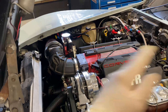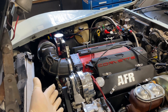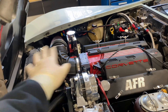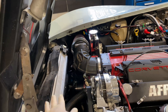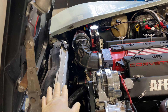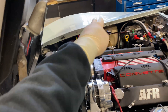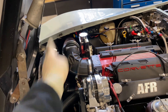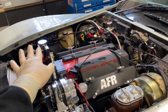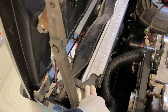The engine computer is going to see water pump temperature and indicate actual engine temperature — say it's running at 175, 180. But if there's some future problem like an air bubble and it's not flowing well through the radiator, the independent probe won't know that. Or if it's really cold out, that system is going to come on at its programmed time, but it won't know the engine needs the fan on. So in the future, it'd be good to find those two outputs, wire them to relays, and make them independent of the fan thermostat.